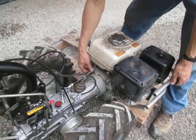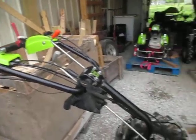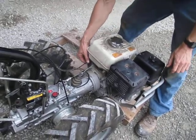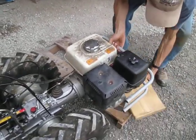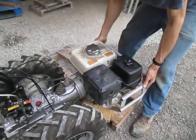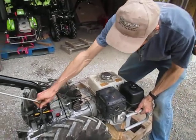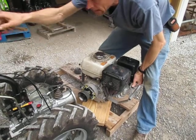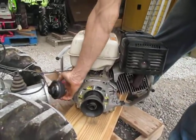I've got all six fasteners removed. I've got the machine situated up next to a crate to catch the handlebars when they come down, and I've got a little block of pallet sitting under the engine here. I'm not going to disconnect the throttle cable — I'm going to leave my throttle cable and my kill switch cable just hooked up on this side of the engine. I'm going to put the tractor in gear so it doesn't roll, and just pull this engine off. Now I just rotate the engine a little bit so I can leave these cables hooked up. And there's the old clutch.